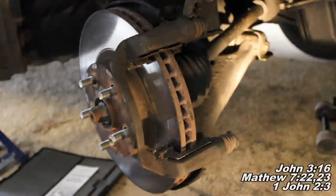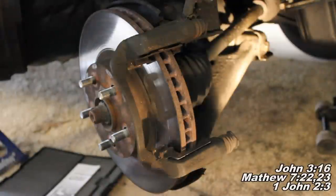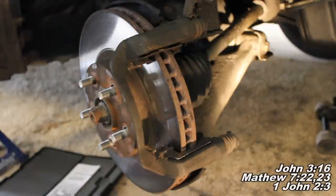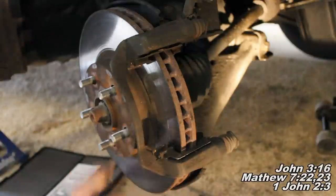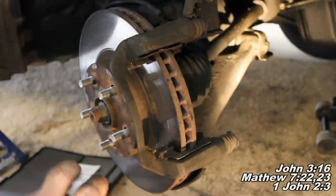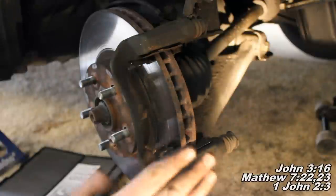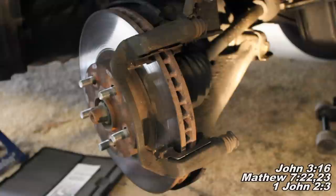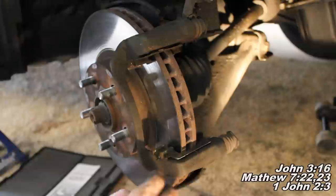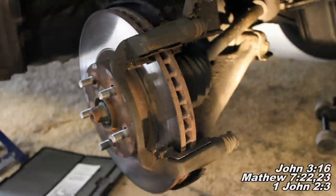If you're particular about it, keep in mind that thinner rotors are more likely to develop warpage. What happens is you'll drive through a big puddle, water splashes on the hot rotor, and it warps. The thicker or newer the rotor, the less likely that problem occurs. Resurfacing will fix the vibration, but it'll come back faster since the rotor is now thinner. If you have the money and really don't want that problem, you can just get a new rotor every time.